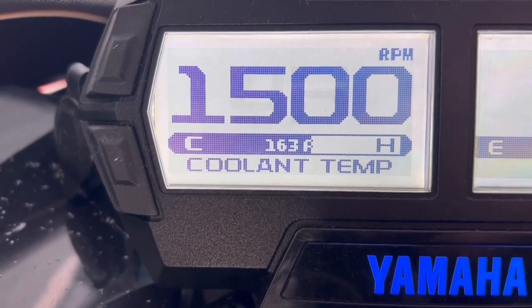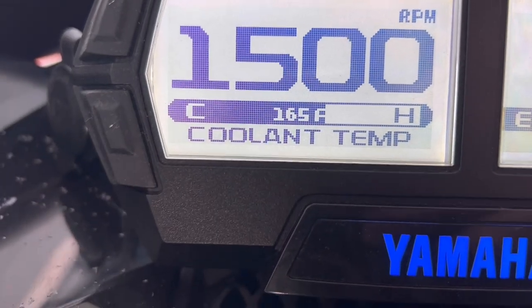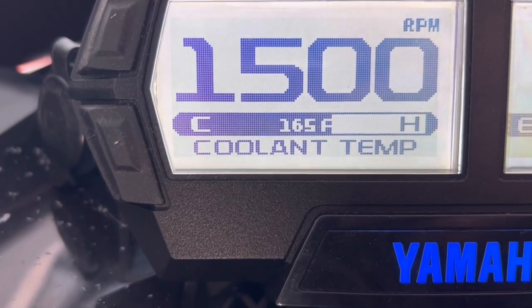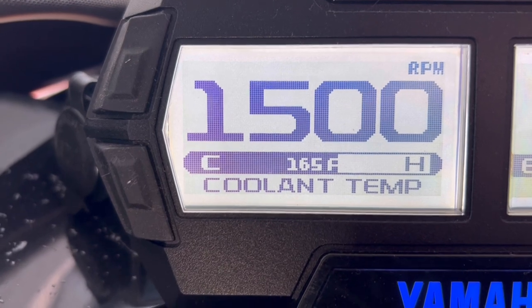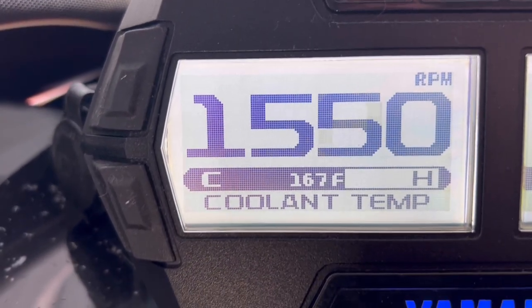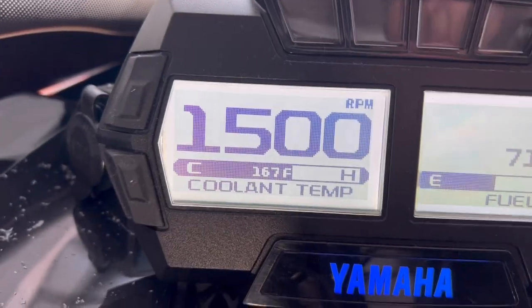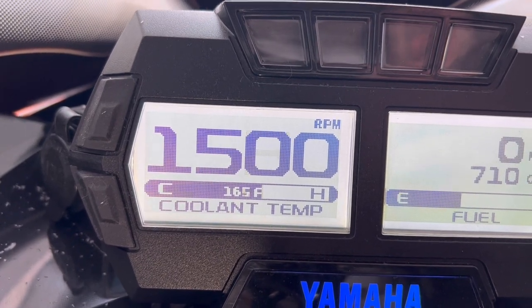So much slower warm-up now — I'm in the trailer, loaded. It just goes up two degrees at a time while it's sitting here idling. That's kind of what you're looking for. When the temperature is bouncing around, shooting to 180 or 190, those are air bubbles. Let this run — just showing how long it's been sitting here idling.